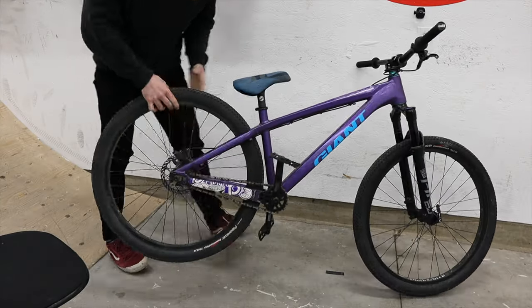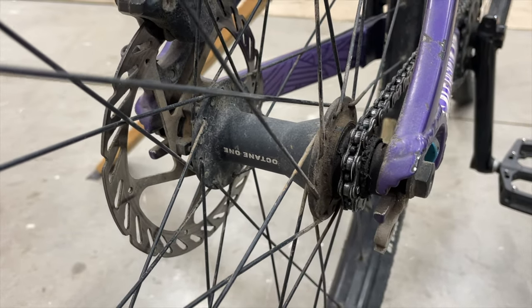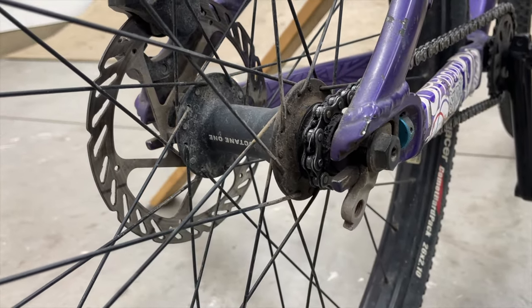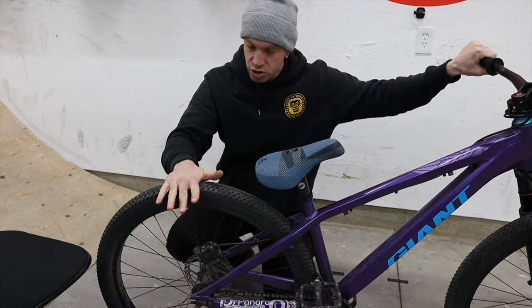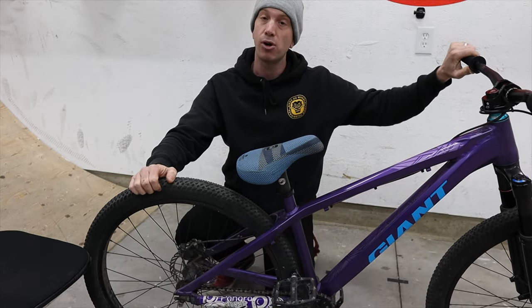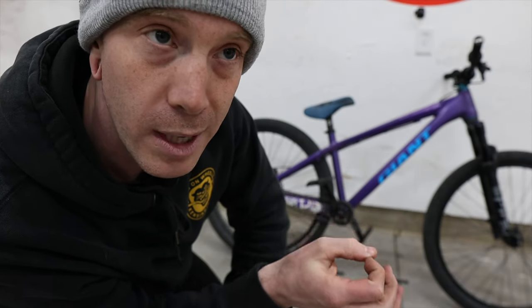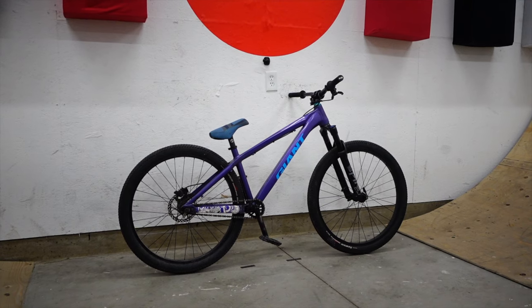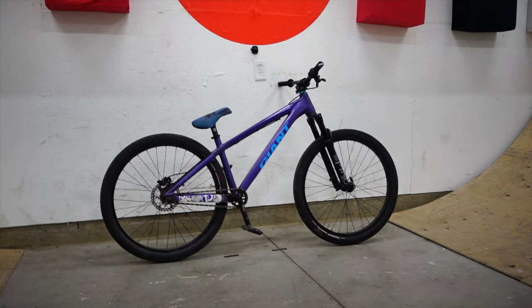For the rear, I looked for a single-speed cassette-style rear hub so there's no freehub body taking up hub flange width, making the hub as wide as possible for the widest spoke brace angle in the wheel build — stronger and able to deal with all the neglect and tough riding I'll put this through. Being always broke, I went with the Octane 1 rear cassette hub from Chain Reaction before they stopped shipping internationally, laced to an Alienation Black Sheep rim. They've been great.